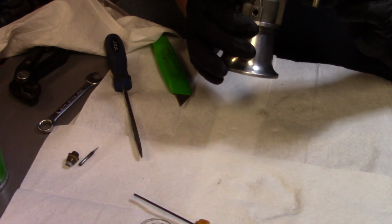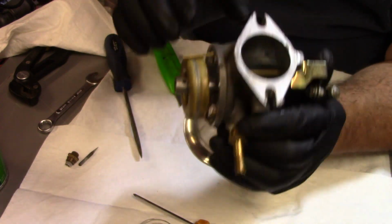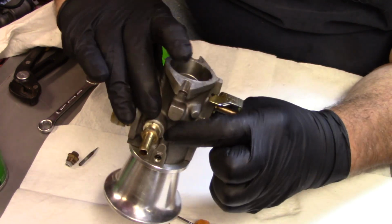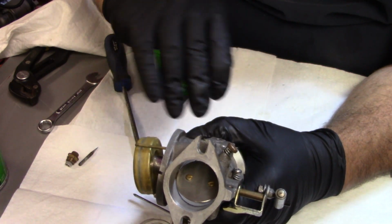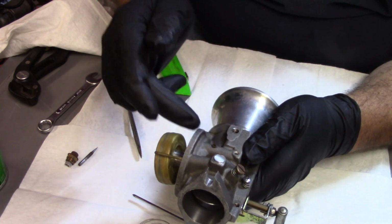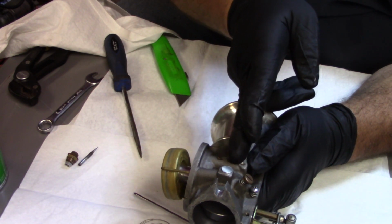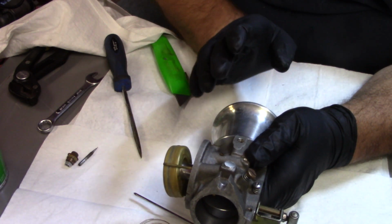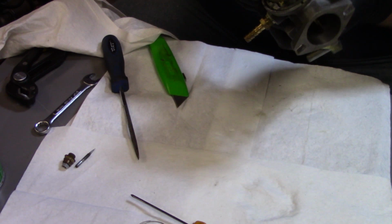I don't think I can show you all on camera. The throat of these, the Venturi, is right in front of the main pickup here. So where I showed you that main jet, it's clipped off to match that Venturi, because it comes in like this and it opens back up. So that main jet, or the emulsion tube, whatever you guys want to call them, don't come up into the carburetor like on standard carburetors. They're real low on these, so that we get maximum flow. And being that it's so big, it still picks up plenty of fuel. So there's all that.